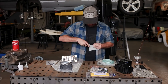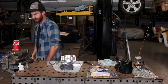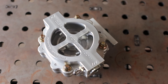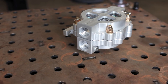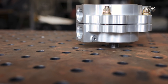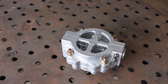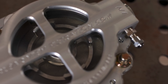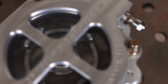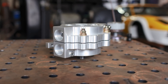There are a lot of parts on the table with plenty more off screen, so I'm starting with whichever one I think is coolest — and that is the Clearview oil filter. This crazy-looking thing is in many ways your standard oil filter relocation kit. It lets you put the oil filter wherever you want in your plumbing system. It's got two inlet ports, one outlet port, and even a small port for a pressure gauge — or in our case, a port for the turbo. Its most noticeable feature is the polycarbonate window in the top, which lets you actually see your oil flowing through it and see when particulates are caught. That's not really a necessity on a normal engine, but on one producing seriously high horsepower under a lot of pressure, it can be hugely advantageous.